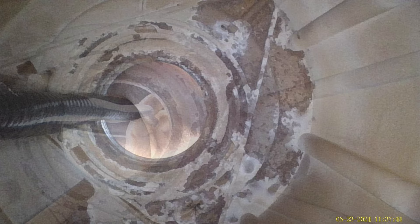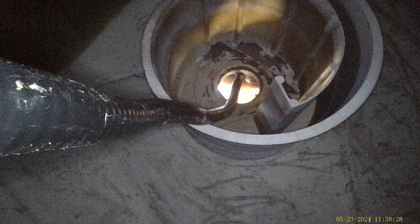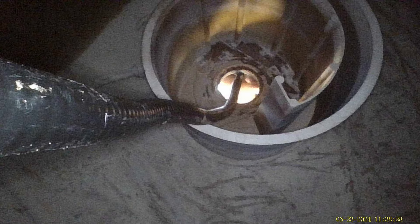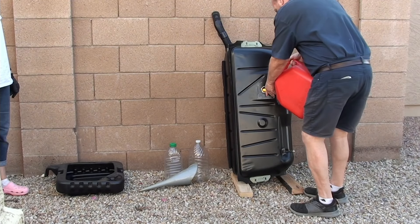This tank is super, super clean. It looks new on the outside and it looks new on the inside. That is the bottom of the tank and that's how clean it is - those little marks are from me probing it. What I'm going to do now is just go get a gallon or two of diesel and slosh it all around inside. If there's anything in there, hopefully I'll get it all out. But you can see with that little vane plastic cover, there's nothing going to get down in there - that's the reason why that screen was so clean.